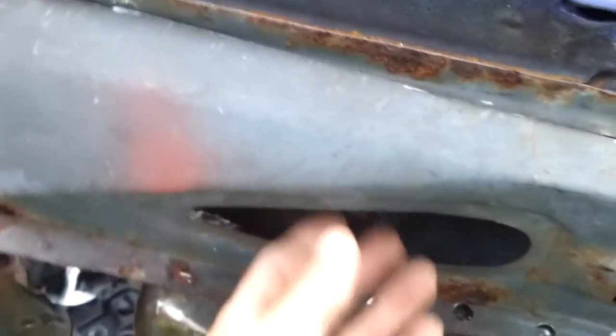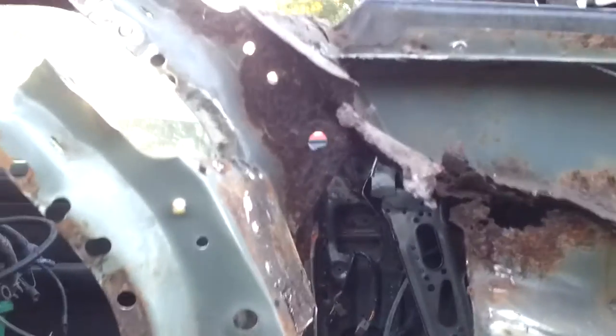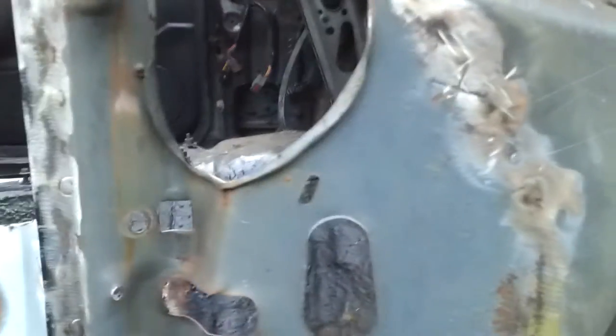This one's a little bit more rusted. The outside piece is already cut off of it. It doesn't look too bad, but once you cut this top piece out you can see there's nothing there anymore. It should look like this one — it has all the top of it there. But when you compare the two, you can see that most of it is gone. So I'll cut it along the top and weld in the new piece.